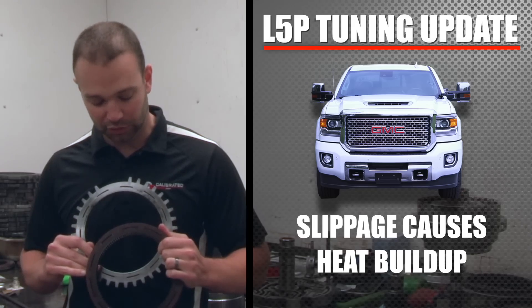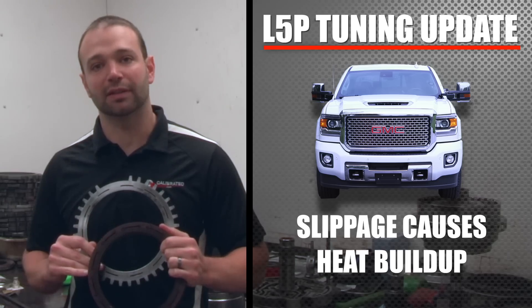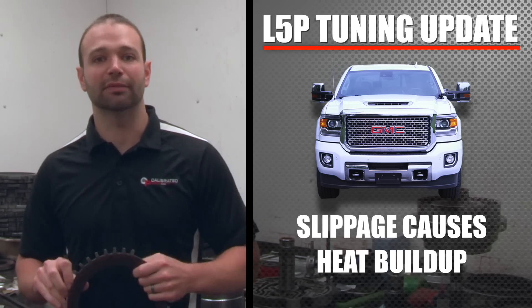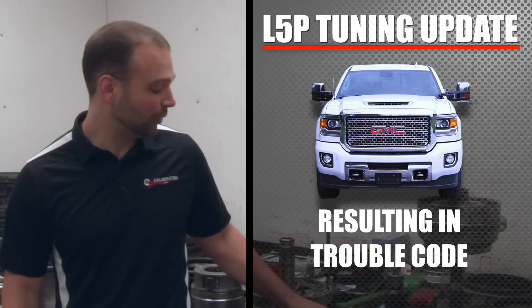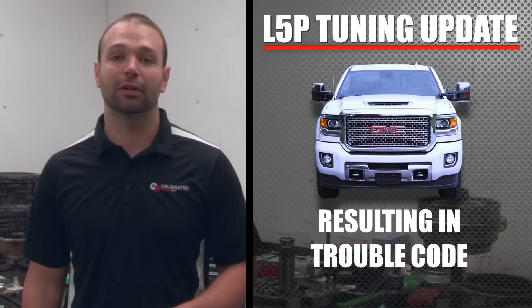As it continues to beat up the C3 pack, that thing gets really hot. Eventually it won't be able to protect itself, it goes into full overheat and full slip — and that's when you get the incorrect fifth gear ratio code. By the time you get a P0735 on an LML or an L5P, you're done — it's time to build the transmission.